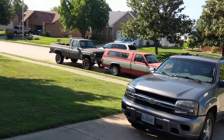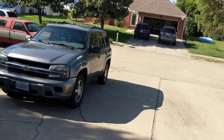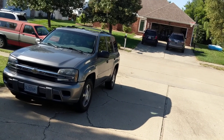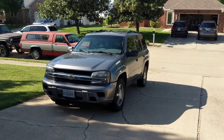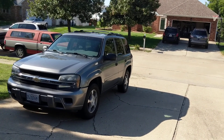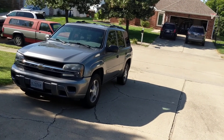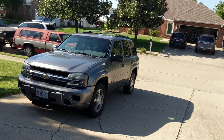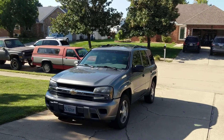The black truck over there was kind of a franken-truck — everything was just kind of rednecked together, and it works for what it is. But on this one I'd like to try and do it all right while I have the ability to. So to summarize: I'll be running the Rough Country 2-inch leveling kit with Hankook 255-65-17 DynaPro ATMs and Bilstein 5100 series gas-charged shocks. I'm looking to get all the suspension components and tires done at once, probably sometime in October before it starts getting too cold. That should be it for updates on this for a while, other than maintenance and fun stuff.